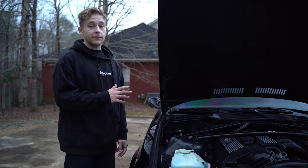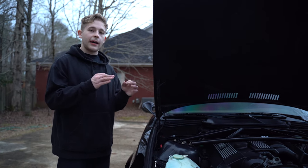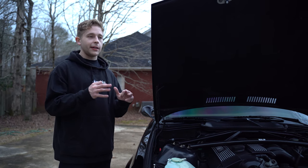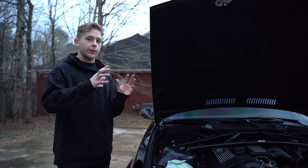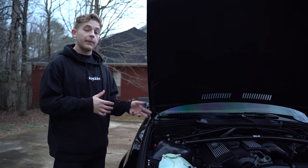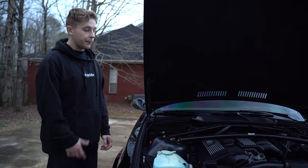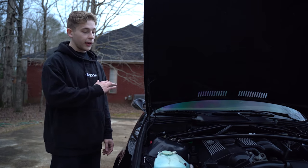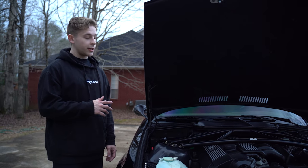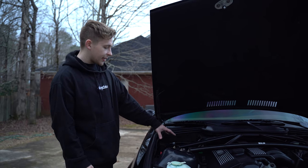I recommend them greatly. One thing to note, the holes where they mount to the head of the engine are a little oversized, but that's kind of a benefit because it gives you a bit of room to make sure they mount up to your downpipe, so you can finesse them, because they're meant to work with a stock downpipe. Obviously, I don't have that anymore. But if you do have a stock downpipe, these are a great upgrade. They sound amazing, and are way lighter than the stock headers too, if that's something you care about. I also have deleted my secondary air pump.